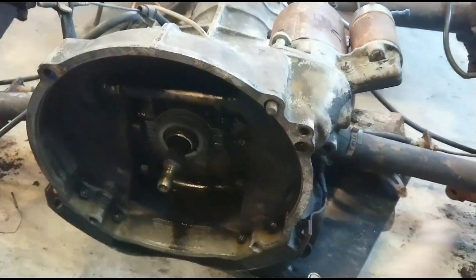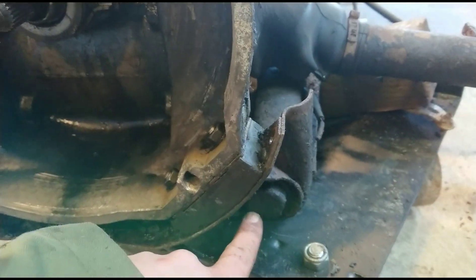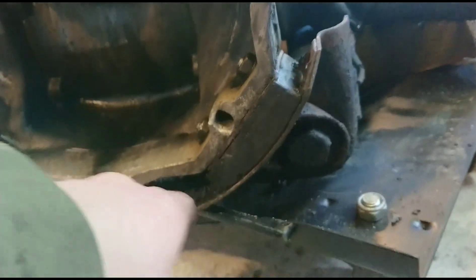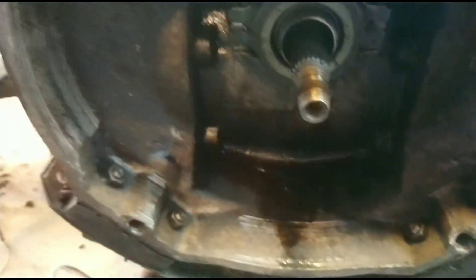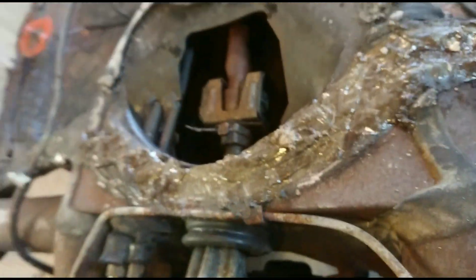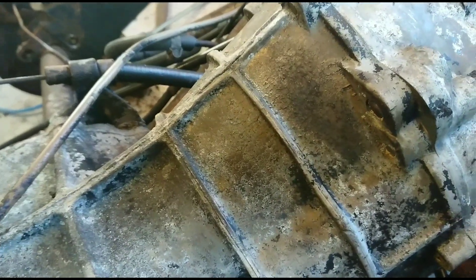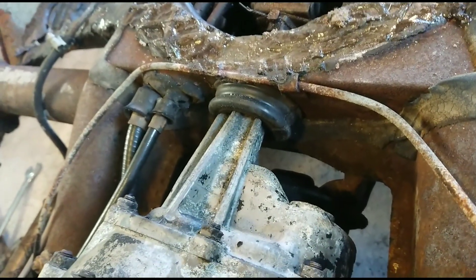Either side's out. There's two rubber mounts here at the bottom - I don't need to undo these gearbox support bolts, they're massive. The gearbox sits on a rubber cradle and you've got two 13mm bolts, one at the top and one underneath. And at the back of the gearbox there looks to be a rubber support - that's a 17mm captive nut, so I've got two of those to undo. Apart from that and the clutch cable, which is just a big egg-shaped wing nut - same as a motorbike, oddly enough - the gearbox should just pull out. Then I'll be able to prop the chassis up and have a good look underneath.